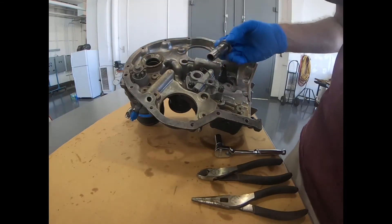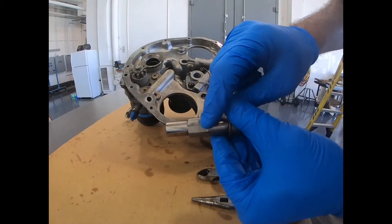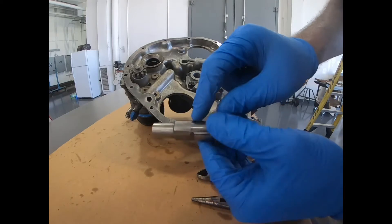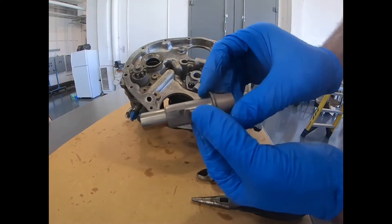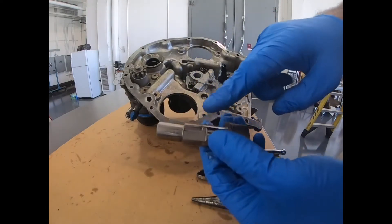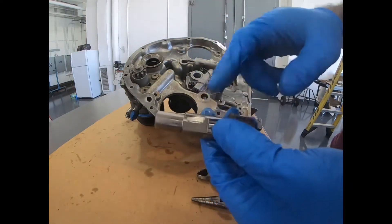So what we're going to do is this oil pump shaft - if you look right here, you can see that coloration. There's a little bit of wear on this oil pump shaft, enough where you can see a significant amount of wear. This thing is always turning, so as soon as the engine starts turning this via the crankshaft, that turns this oil pump and drives the gears inside. So we're going to replace this shaft, and as a result I'm also going to replace the oil pump drive gears that sit inside this since this is worn.